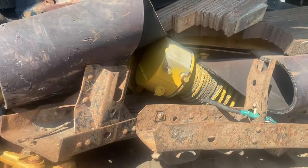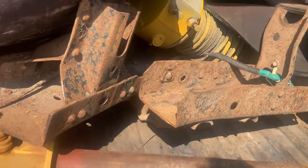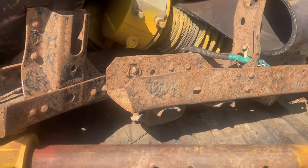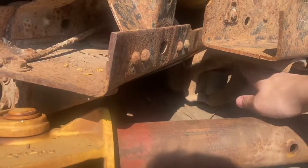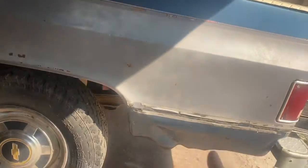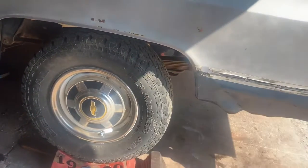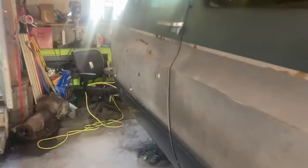I have a four-wheel drive cross member on the other side — that cross member I think is actually from the Pathfinder. I've got all the mounts for the shackle flip, which are still connected to the leaf springs. That's the rear leaf springs out of the monster truck. There's the shackle mount with the flip. For the front I think it'll be about six inches of lift, so for the rear I shouldn't need both the shackle flip and lift springs — just the shackle flip, maybe some extra leaf springs to make a stronger pack. That should lift it to where I need it. If I've got to put a little block in there, that doesn't work me too much.